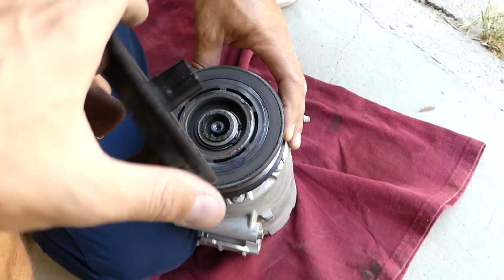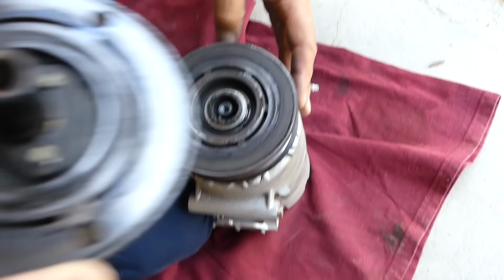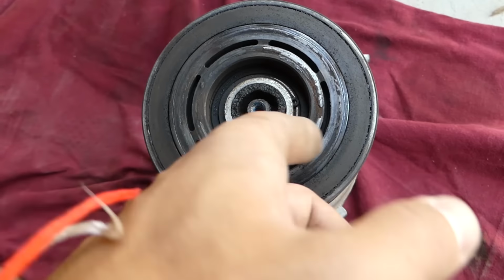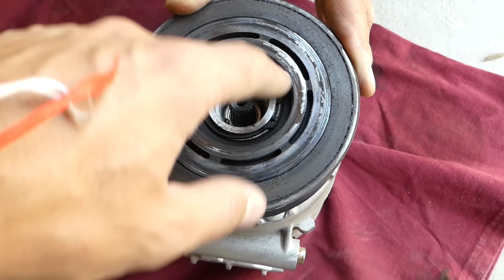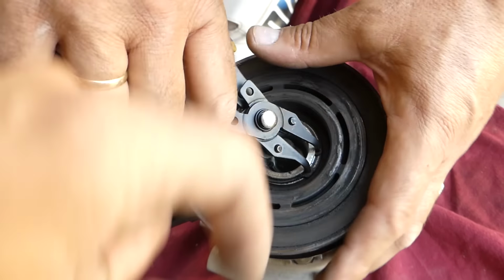Now this is the top part of the clutch right here. You can see this is the clutch, and ours smells completely burnt. After that there is a lock ring right here that we need to spread out to pull it out. This could be very dangerous, so always wear eye protection, because those are spring loaded, it might fly. We have all the tools we use in the description of the video below, so please feel free to check it out. Always hold your hand so it doesn't fly in your eyes. Right there. Now this one could be a little bit stuck, you kind of pull it out.